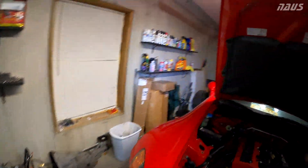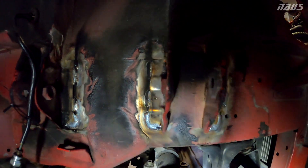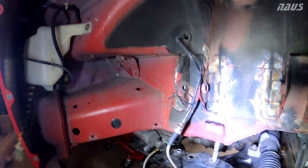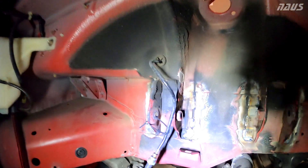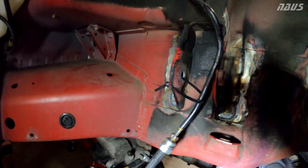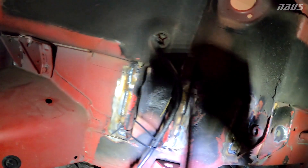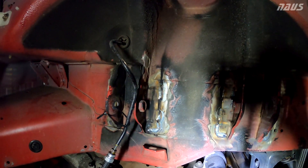That's an overview of the four edges we welded. The other side looks very similar — all kinds of good welds. This thing is on there indefinitely now and is never going to pull off. I took the fender liner off on both sides to prevent it from catching any sparks and melting. I had to pull the brake lines away from the bracket and torqued them to the left and held them there with a zip tie so we had plenty of clearance to get the welder in on both sides.